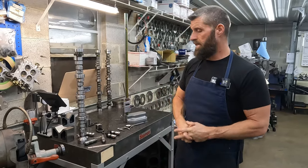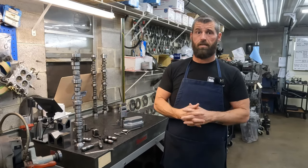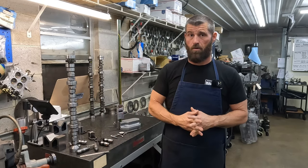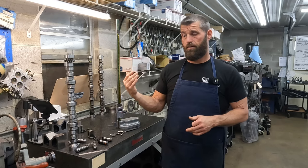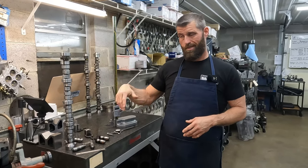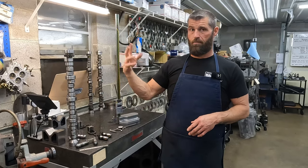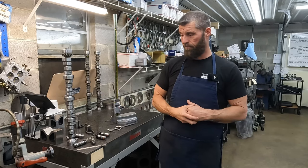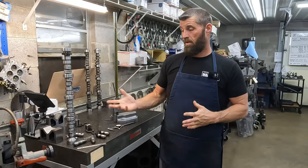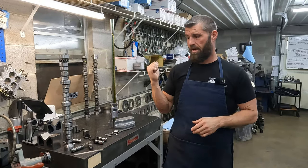A lot of people put this stuff together, stick an intake on it, never look at it, and end up with valve train problems down the road — they didn't know it was bleeding to death. On an FE it oils through the cylinder head to the rockers, so you'd still only have oil to the hydraulic unit half the time. On a big block Ford it oils through the lifter all the time, unlike an FE. Hope it helps. If you need Gaterman lifters, we're getting some in every 30 days or so — get on the waiting list, give us a call, check out the website. Thank you and we'll see you on the next one.